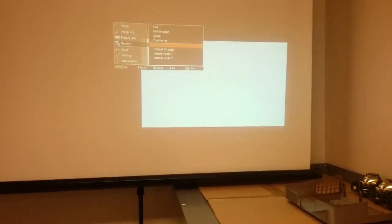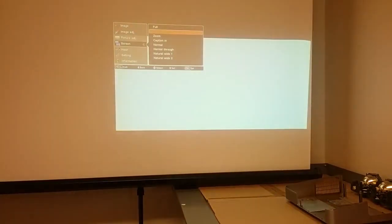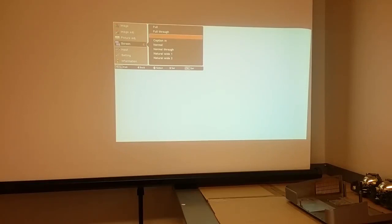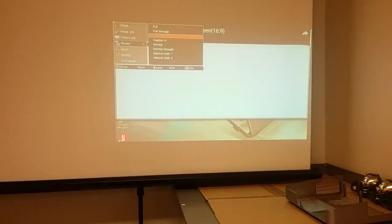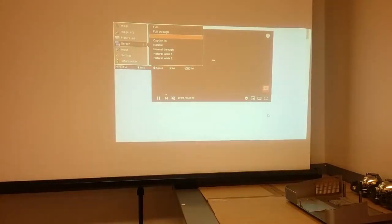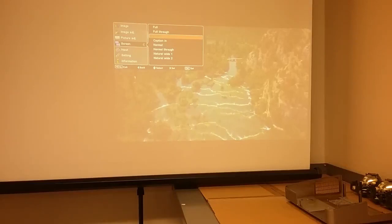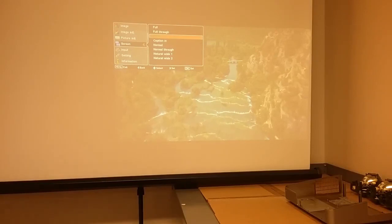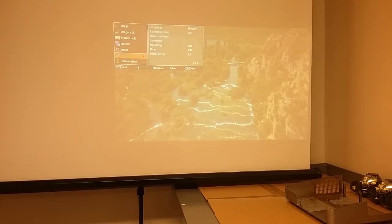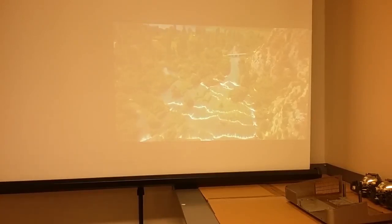I'm going to see if I can leave these wires in and just disconnect these wires. We'll see how that back plate is. What's holding this down? Actually, I'm going to leave these two plugged in, but not these. These are fans or temperature sensors. Alright, so then to unhook the LCDs, these are ZIF connectors. Just push the clips out. Then that ribbon cable can pop right out.